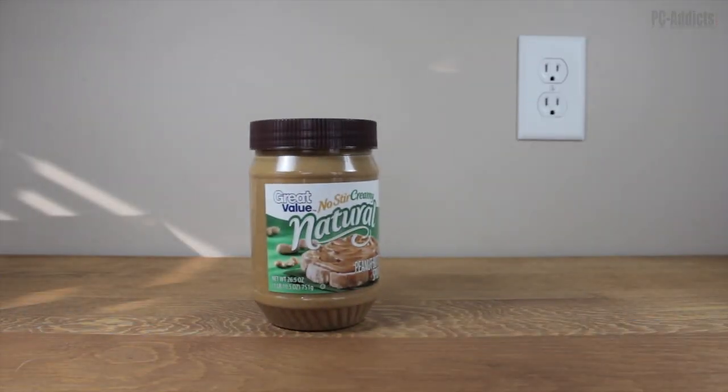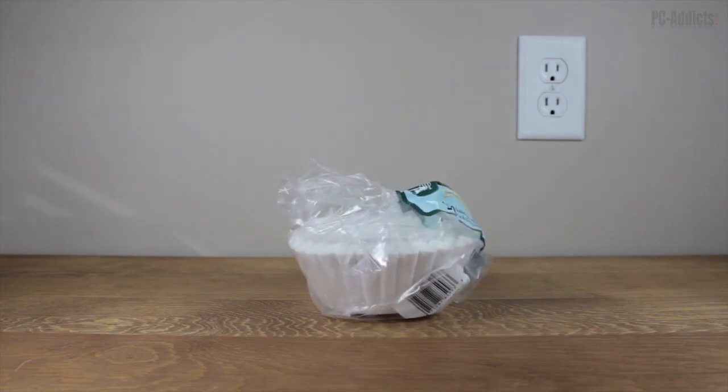So I thought it would be a perfect time to shoot this video again and compare a few different typical household products that you may have laying around the house — each containing a tiny bit of abrasiveness, enough to help buff out any defects and scratches on the surface of the disc. I tried peanut butter, toothpaste, and finally car wax. In the beginning I used a coffee filter as an applicator, but in the end I would suggest using a soft cloth like a 100% cotton t-shirt.